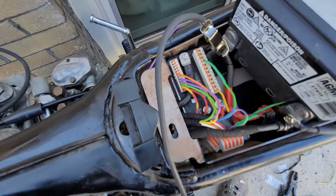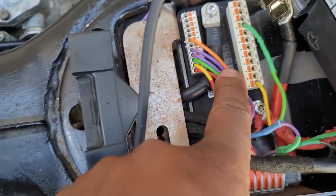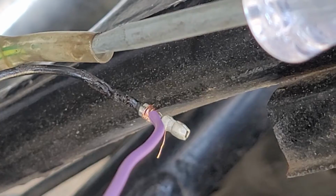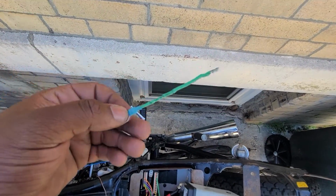After verifying that the buttons worked, I shortened the wires to clean it all up, and I focused on the brake light input switches. Now, from the factory, this rear brake switch gets positive power through a black wire and directly sends that power to the taillight when you hit the brake through this green wire. On an M unit, it's the same concept, but instead we'll be using negative, or ground, using this connection to